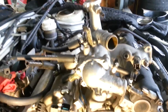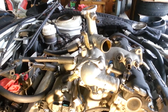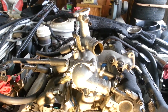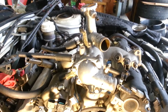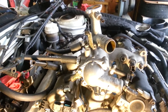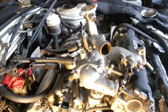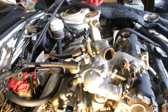When you replace the thermostat, don't assume the new one's good. What I do is I put them in a pot of water and heat them up — the new one and the old one — and just take notes on what temperatures they open and close at. The old one was definitely beyond its service life and wouldn't even open up until about 190, and it closed really slowly, only after reaching 160. The new one responded much better and opened right at 180 and closed at about 170.